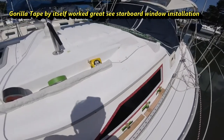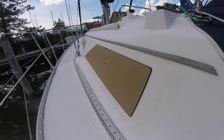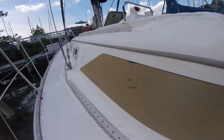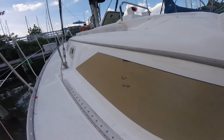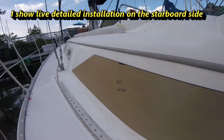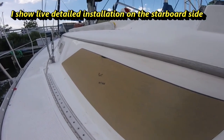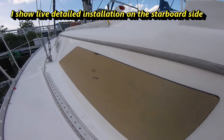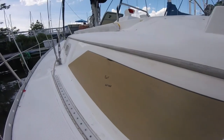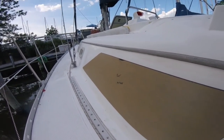So now it's a matter of starting to pull off the tape. Well, I got it secured. It is kind of interesting when you do it, but I feel like all the supports I used did a good job. The next thing I'm going to do is I'm going to tape around it, leaving about an eighth of an inch gap, and I'm going to use the 795 silicone black around the edges. And that's another thing that's recommended by Andy Miller at Quiltworks.